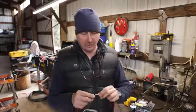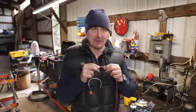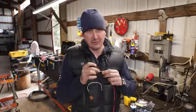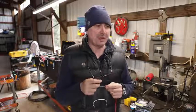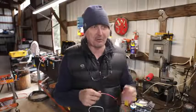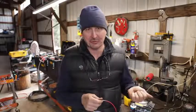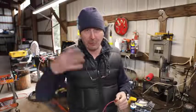That's all there really is to it for connecting wires. That's going to be your best connection — if you can take a little more time and solder with shrink tubing instead of using those blue automotive-style connectors, you're most likely not going to have to go back and redo your electrical work, especially for stuff sitting outside like trailers or boat trailers where there's a lot of water and spray.